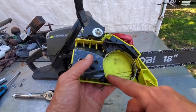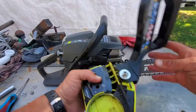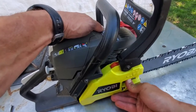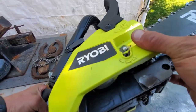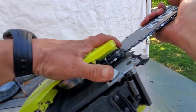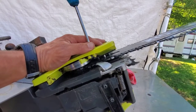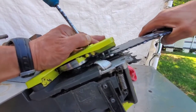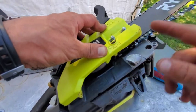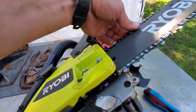This is the little spring on the inside — this is your brake. If this brake lever is forward, the spring is going to be squeezed in and it's never going to go over your clutch assembly properly. Put the cover back on. The adjuster can move, so if your pin is not adjusted right, you can wiggle the bar a little bit. If it wasn't loosened quite enough, you just have to loosen it until that pin drops in place where it should, and then you'll be able to put the cover on. If that adjuster is out of whack from taking the old chain off and putting the new one on, you need to adjust it to make sure it lines up or the cover will not go on right.